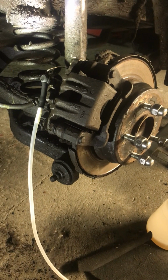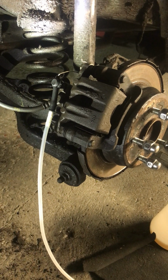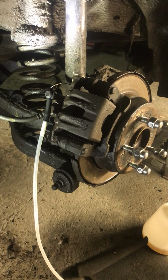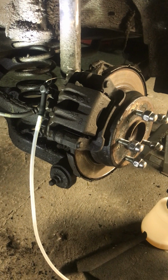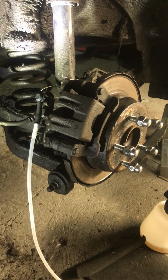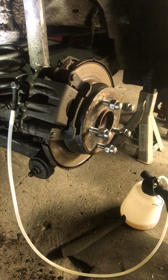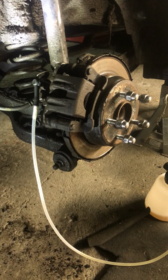So anyways, I checked over the whole system, and as I said, that's the copper washer. It's the only thing I could find. It took a couple of hours, and how I found it was there seemed to be just a wee little weep of hydraulic braking fluid around that washer. So again, I hope that's it. I'm ready to go back on the road now and give it a test, and hopefully that's it. So I originally started bleeding the brakes.